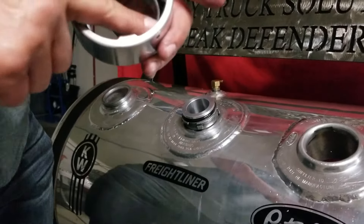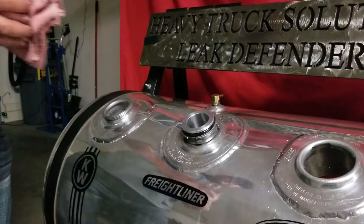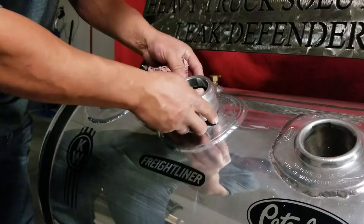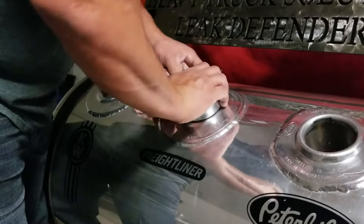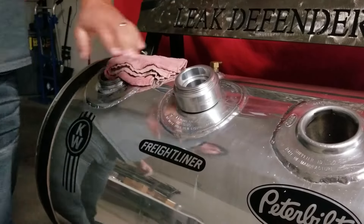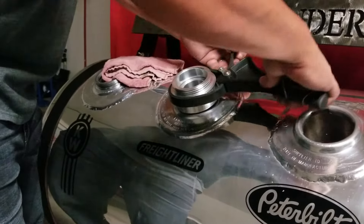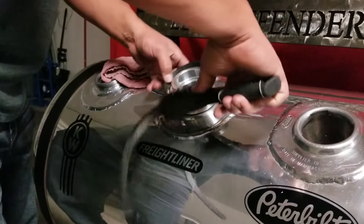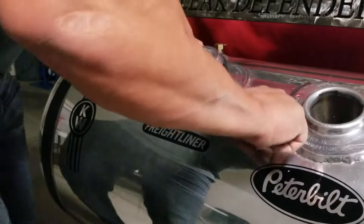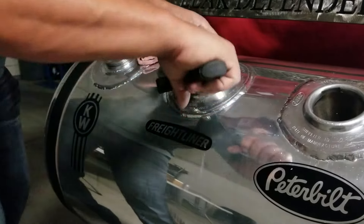Here's your collar. Make sure that that's lubricated. Then it goes on just like your factory cap used to fit over. Snap down, start to turn by hand. Once you get to that point, use your non-marking strap wrench in place. It's a clockwise turn — give it a clockwise turn and you can feel it snap into place just like your cap.